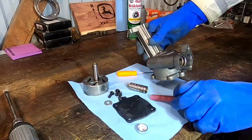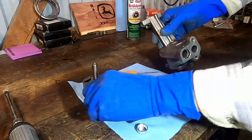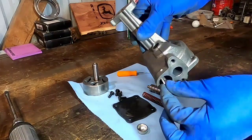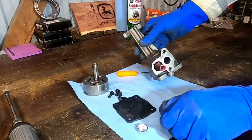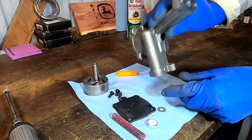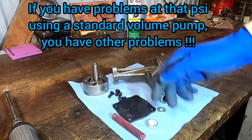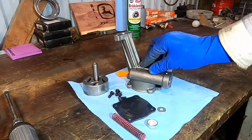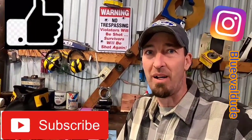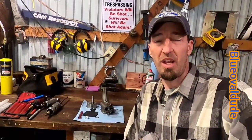If you want more pressure, what I do is assemble the pump, put the bypass valve back in, put the spring in, and then take a regular washer that fits inside the bore and put it behind the spring. Then palm the soft plug all the way in, and if you do that you'll usually have around 60 to 65 PSI, which isn't too tough on stuff. Hit that like, share, and subscribe. Thanks guys — until next time, keep racing, keep wrenching, keep having fun with your hot rods. Have a good day.